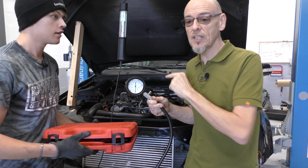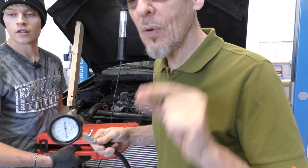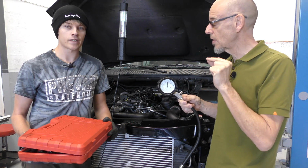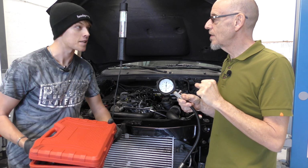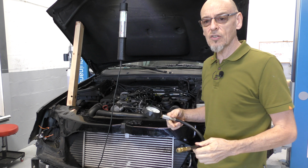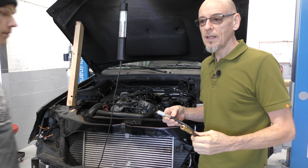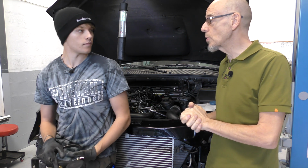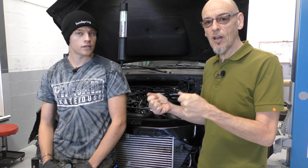Yes. Yeah. This engine gave us exactly the same on all 5 cylinders. Yeah. Exactly the same. And if anyone's interested, it was 320 psi on this engine. Yes. And the thing that we're trying to get across is that before somebody rips your car to bits, which is what has happened to us, there are lots of other things to check.